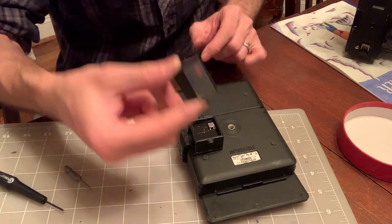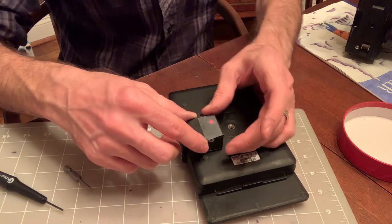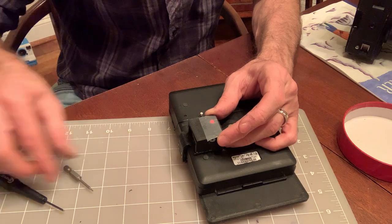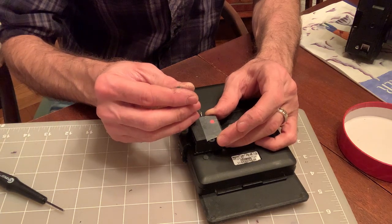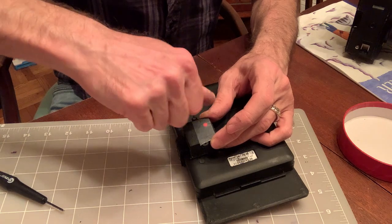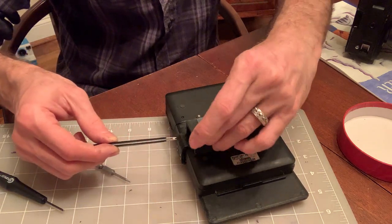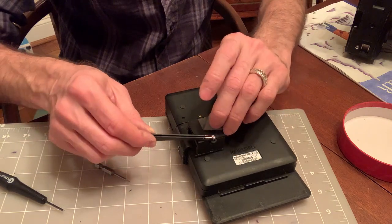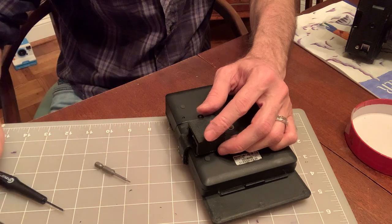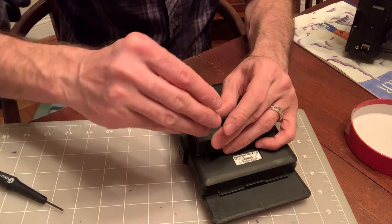All right. Next step is to attach the cover that also holds the eject button. Put it down and reattach those 2 long screws that secure the eject box cover to the eject box. Remove the tape a bit. At this point you can remove the tape completely, it's not going anywhere. That's really just to hold the button so it doesn't fall inside when we perform the assembly. I learned that trick the hard way.